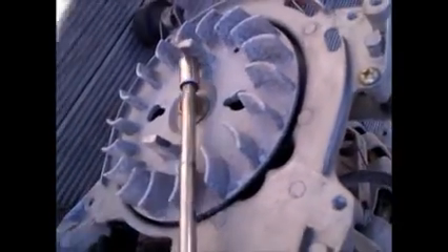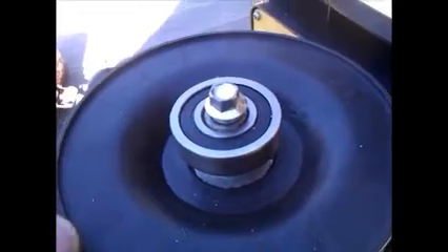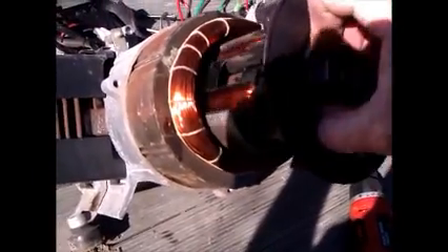On the other end of the motor, use a lever or some sort of leverage to stop the whole shaft turning. Be very careful not to break the small plastic fan — they snap very easily. Undo the main bolt a little bit, then lift the plastic cover with the whole generator and give the bolt a smack to separate it from the shaft.